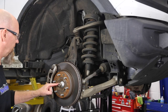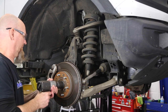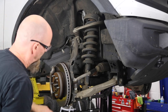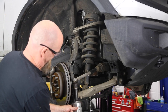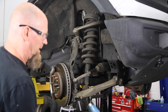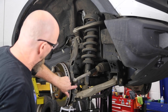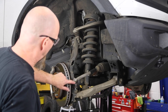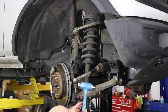The first step is to remove the stub axle nut — it takes a 35mm socket. Then grab a 21mm for the tie rod. Take a steel hammer and give a good couple of wraps right on the end of the steering arm, and that'll pop that tie rod up and out. Make sure your hammer strikes are nice and flat.